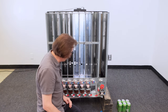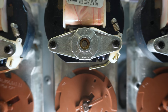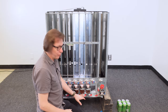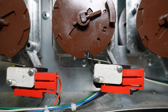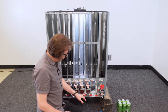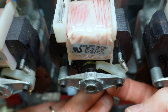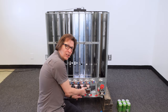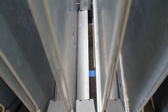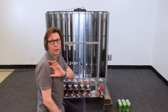I like to manually open the cradle. On the motors, there are several different components — there's a brake on the motor that sits at the bottom, and you can lift it to lift the brake off of the actual armature. We also need to pay attention to the home switch — the little cherry switch at the bottom that rides up against the timing cam. We want to push that down and out of the notch of the timing cam. With my ring finger I push it down, my index finger pushes up on the brake to release it, and then I spin the armature anticlockwise. I keep spinning it until that cradle slowly opens up into the half-moon position, and I'm able to reach in and pull the actual shim right out.